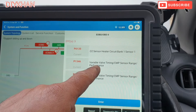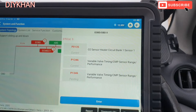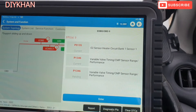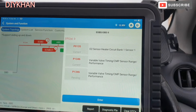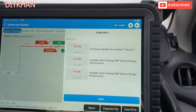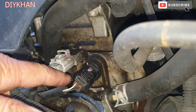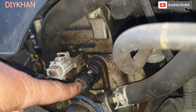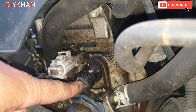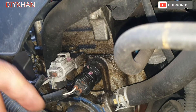The middle fault is the camshaft position sensor which has got the issue. We've managed to get the part from eBay for 15 pounds. Just going to show you the location of the camshaft position sensor on this Toyota Yaris. What we're going to do first is press this clip here to get the connector off.